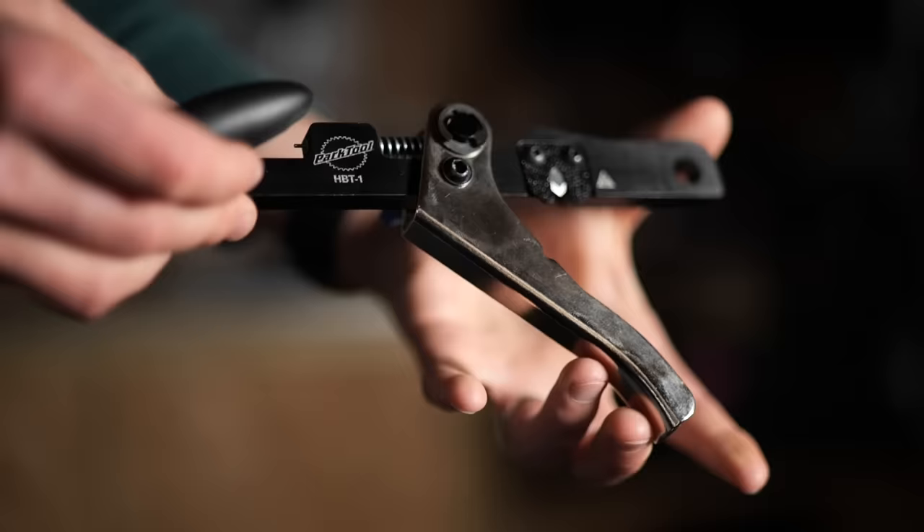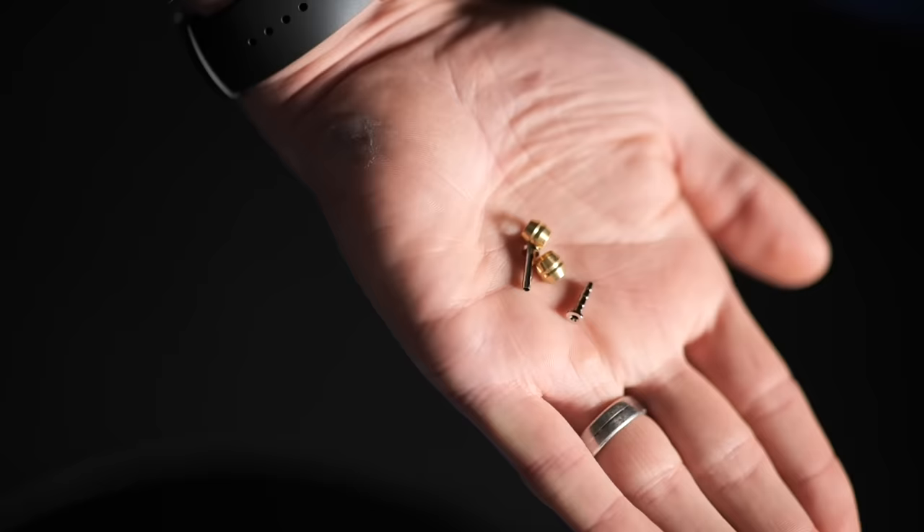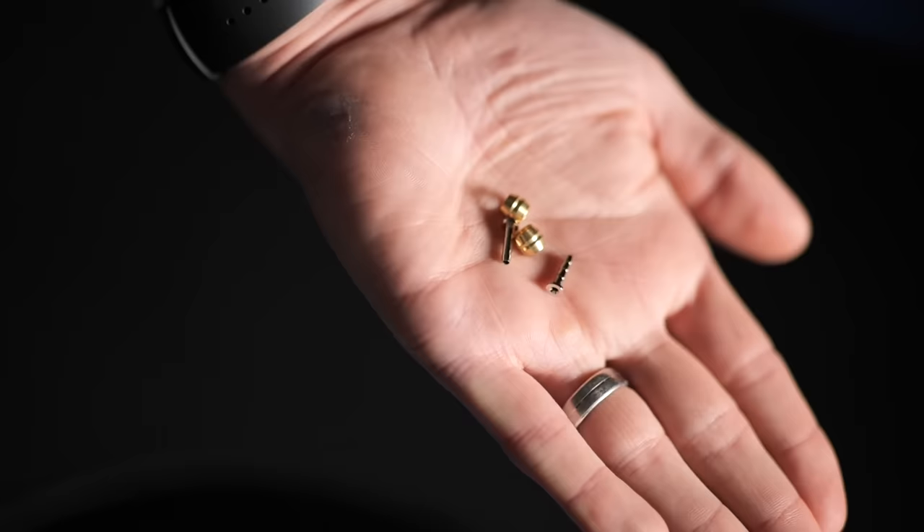This cutting tool is one of my favorites from Park Tools, but there's loads of different options to choose from. You're also going to need a new barb and compression fitting. Shimano have got two different options: the BH90 or the BH59. This is typically stamped onto the hoses, but if you look up the caliper model code online, you'll be able to find out what you need.